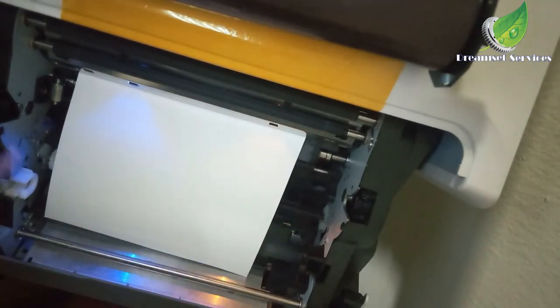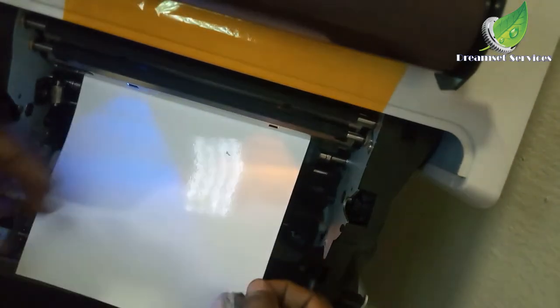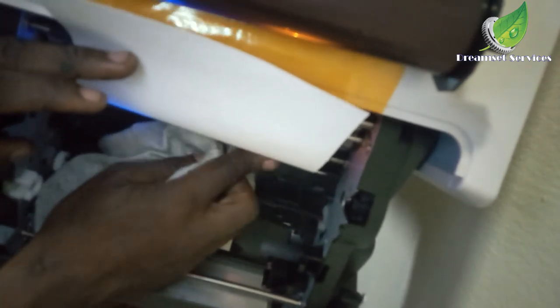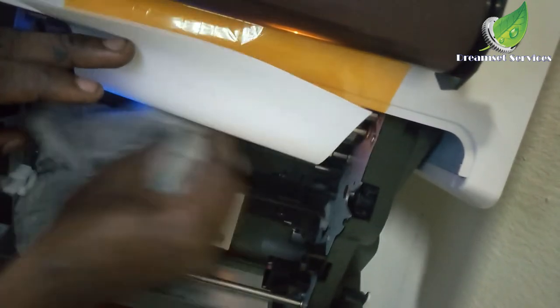The kind of grease I'm going to use is a specialized grease that is mainly for printers. I have it in a syringe so I can get access to all the parts of the printer I want to grease. I'm going to apply grease and then clean out — there is a roller that I'm going to clean also, just to make sure everything is fine, because this particular area over time builds up dust and the roller is unable to spin the paper the way it's supposed to.